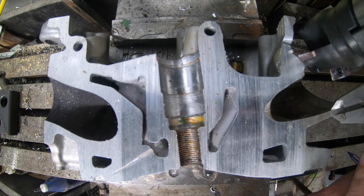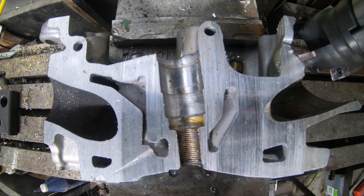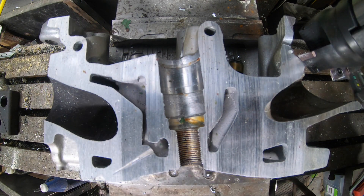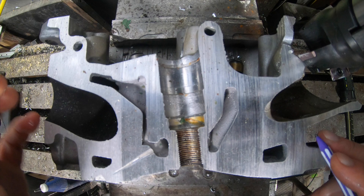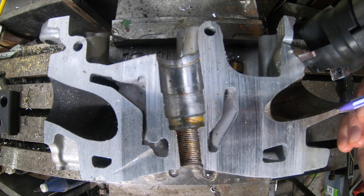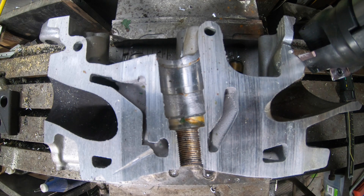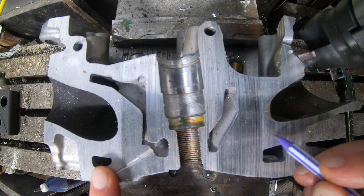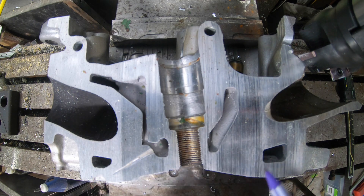About the thinnest part we're seeing so far is just a hair over four millimeters on the intake side, and it's got kind of the same thing going on on the exhaust side. On the intake side you can port this a little bit more than you can on the exhaust side — you just need more bulk there. So at a minimum this is looking like the minimum wall thickness, and you probably have at least a millimeter around every wall. What I'm really curious about are these two water channels — where the port does that sharp inner curve.